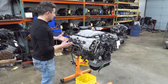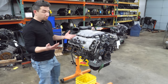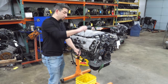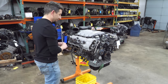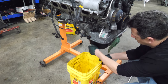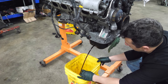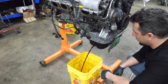One of the first things I noticed is that it has water in the plug wells because it sat outside and got rained on. Some of the places I buy engines from don't have the room to store cores inside. I bought it anyway, and I was going to flip it over to drain the plug holes - but then I checked the oil and it turns out it's completely full. I'm so happy I didn't just flip this engine over, because it had water in the oil.